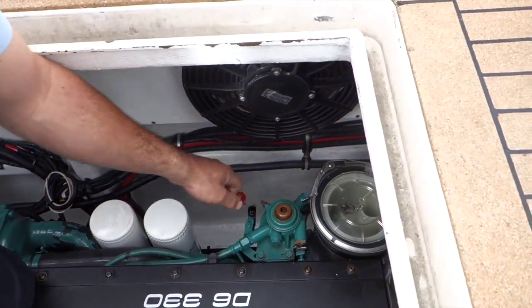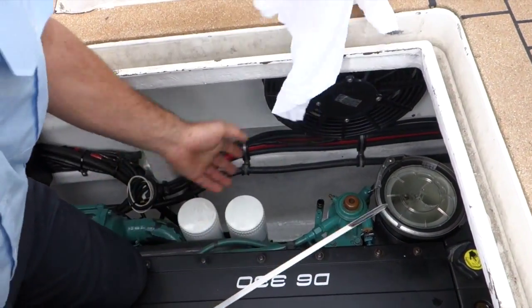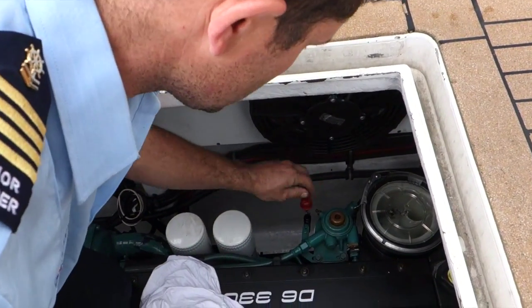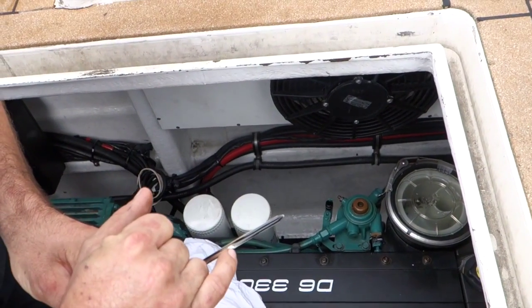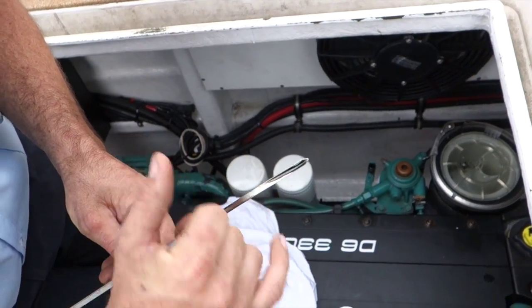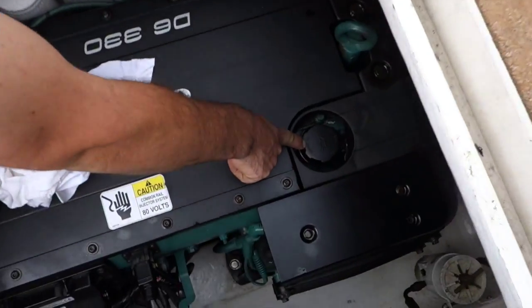The other thing that we've got here is the engine oil dipstick to check the oil level. Pull the dipstick out once, wipe it clean, and then dip it again to check. There's a max mark here — you can see that we're pretty much on the max mark — and there's a minimum mark there. If you need to top the oil up, oil is stored under the sink in the cupboard and the oil is filled through the black cap here.